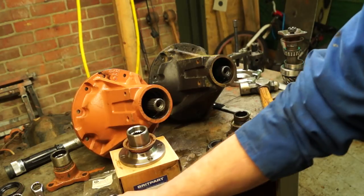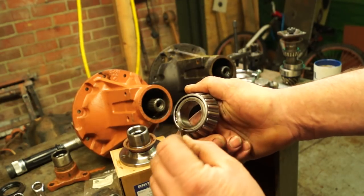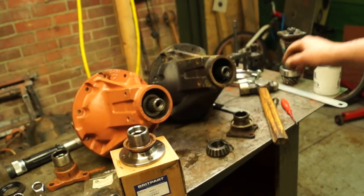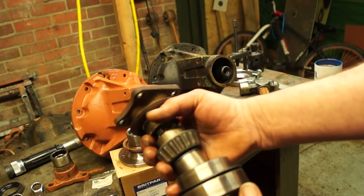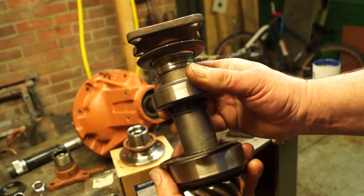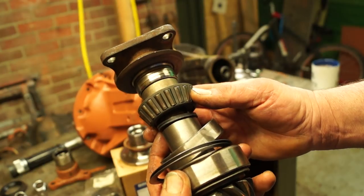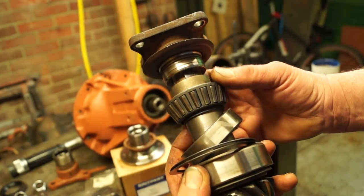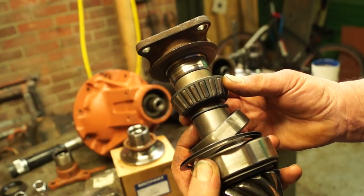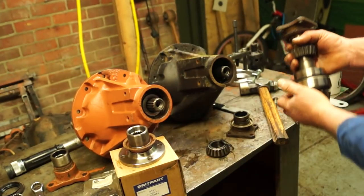One important thing — a potential problem I noticed: if the bearing falls out and you don't know which way the shim goes in, the shim goes in this way, holding a spacer to give you the correct bearing preload. You have two bearings, and you have shims for the pinion bearing; on the other side you also have the small shims. Remember — they don't go on the flange side, otherwise you will lock the diff up. That is vital. I've seen it done and it's not good.